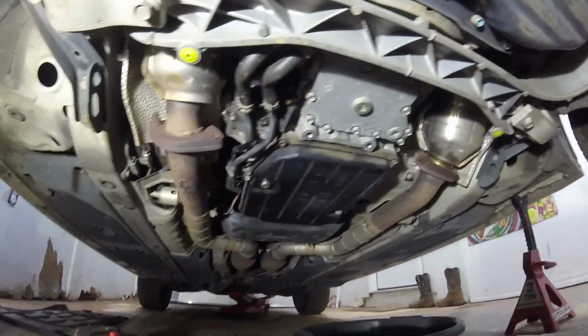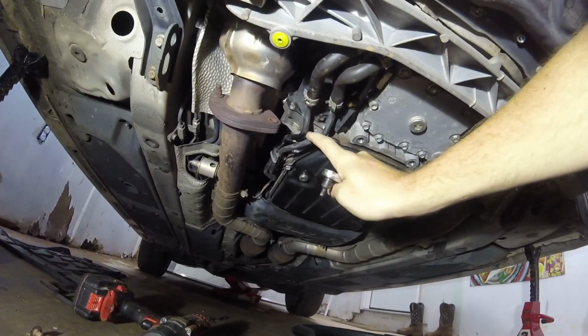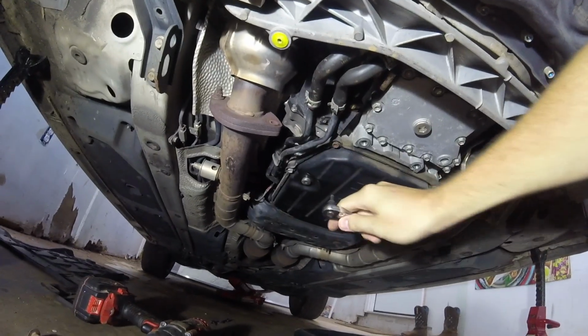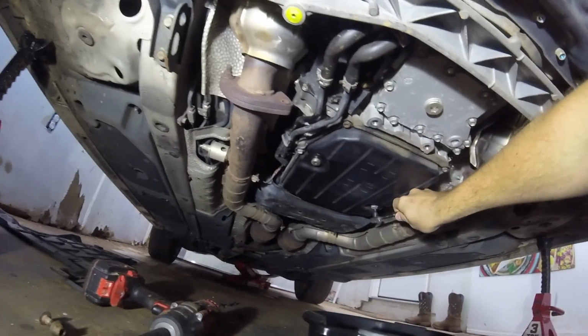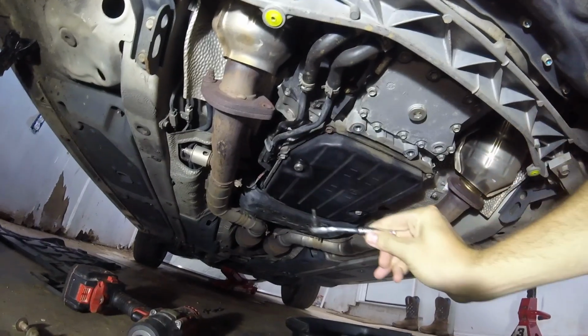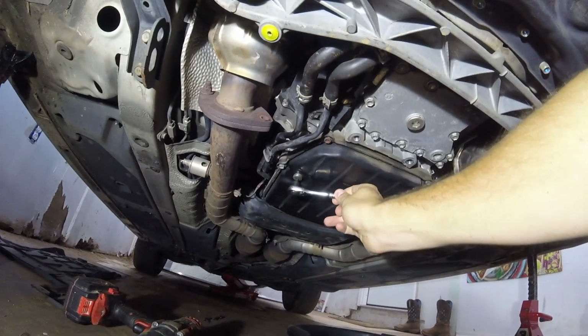And then we're looking at the pump right here. Alright, so we do have to move these pipes to get to the motor there. So I'm going to drain the transmission fluid. That's the drain over there, I'm pretty sure. But this is the level checker thing. It's a 4mm hex. So I'm going to take that out and drain the fluid.